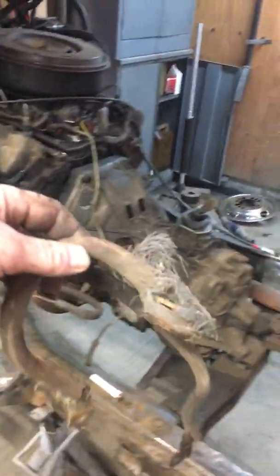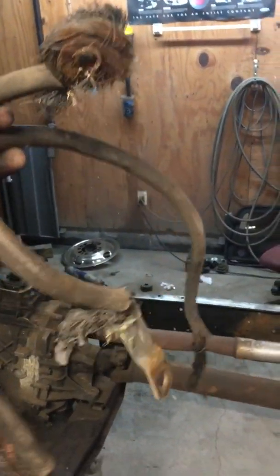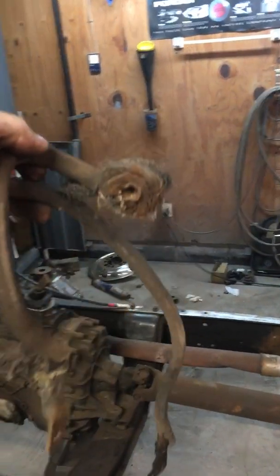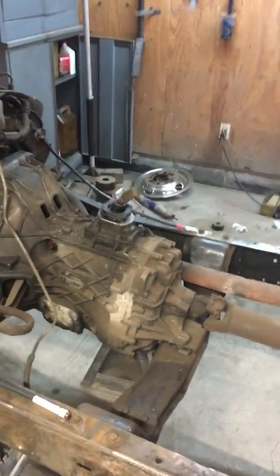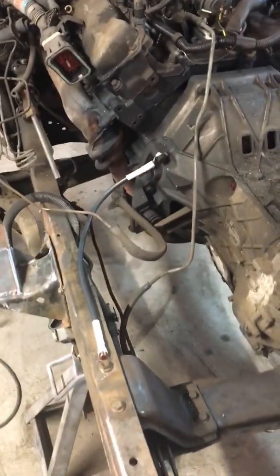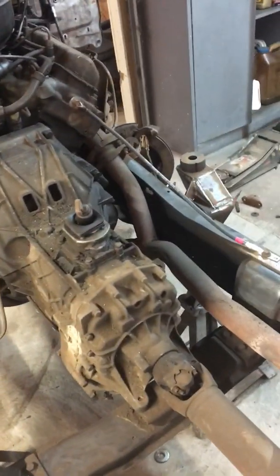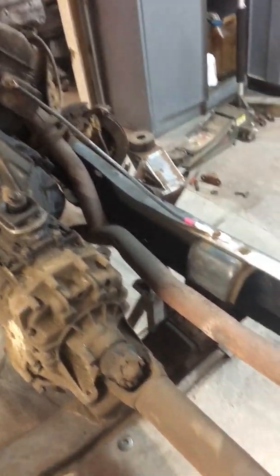that the previous owner had done. So this was their grounds. Okay. So I'm guessing they probably had some hard start problems at some time, and no telling what kind of electrical problems they had. So anyway, we took that off. We run one ground from the engine block over to the frame. Of course, all the connections were soldered and cleaned really well. Ran one from the head over to the frame just because that was a convenient place.